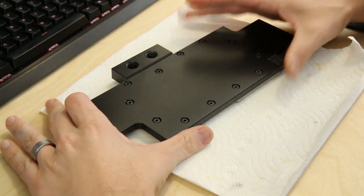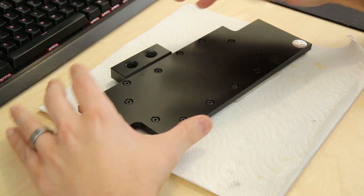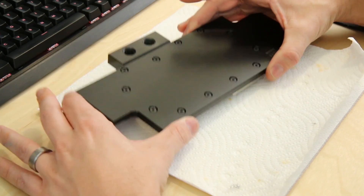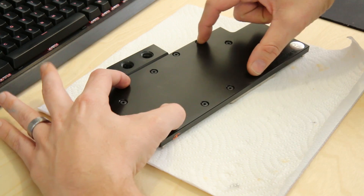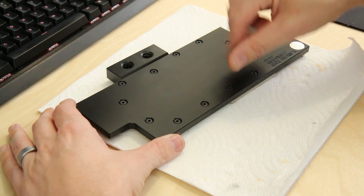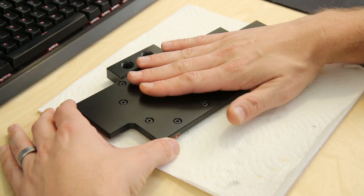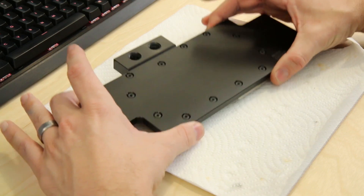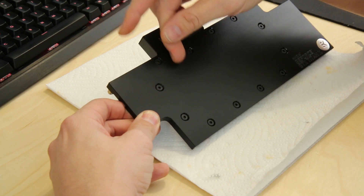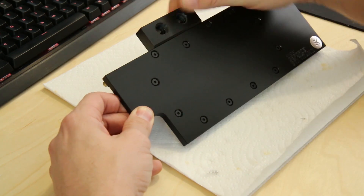Here it is put back together. I really didn't think that the pastel - or I should say the nanofluid - was going to be the problem. It's the nanoparticles that I was thinking might have somehow been getting clogged, but I doubted it since they're extremely light and people haven't mentioned pastel clogging before. When you put this back together, do the four corner screws first to hold it in place, making sure that O-ring doesn't pop out. Then put in the other screws real light, and work your way around and tighten it up in a star pattern. Remember, it is easy to strip this - even the copper base, since copper is still a soft metal. This is threading right into the acetal material, which is just a plastic, so it's going to strip really easily. It doesn't take a lot of force to make a good seal with that O-ring.